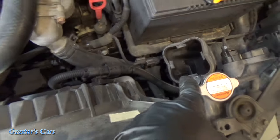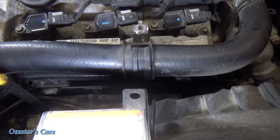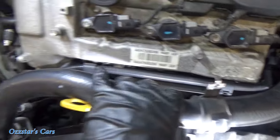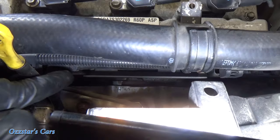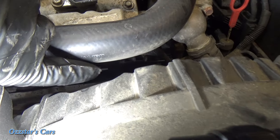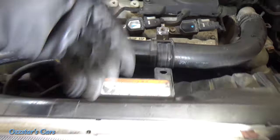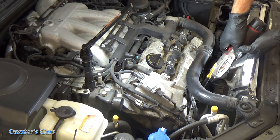With that air intake piece out, it's easy to get in here to the duct area. I need to bring you down here to show you two more bolts. Behind this upper coolant hose there's a wire harness zip-tied to a bracket. You need to get this bracket out — there's one 10 millimeter bolt here, and another one catty corner about three inches back. Take those two little bolts out and that will release this harness so it can be pushed back towards the front of the car.